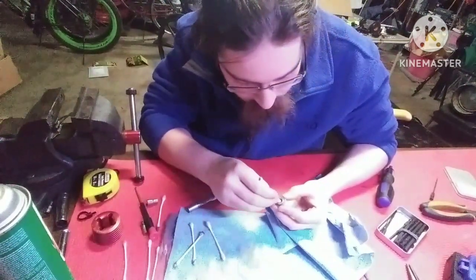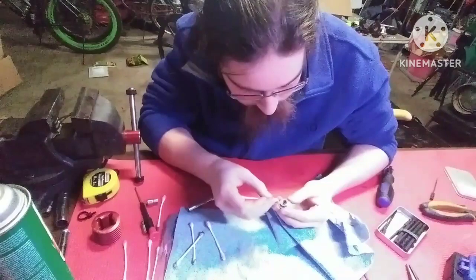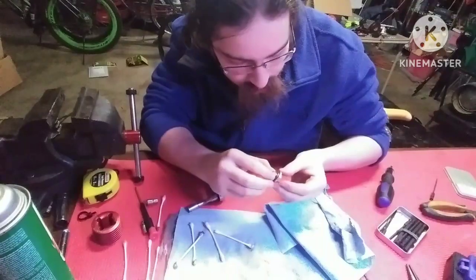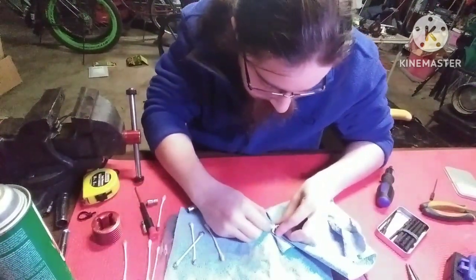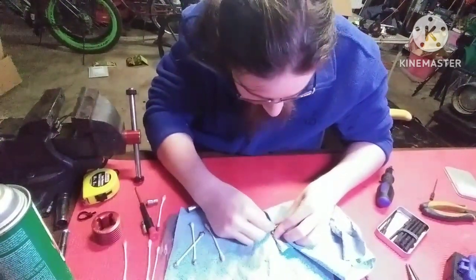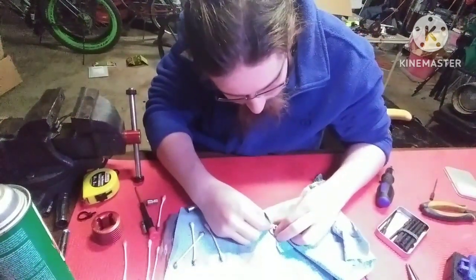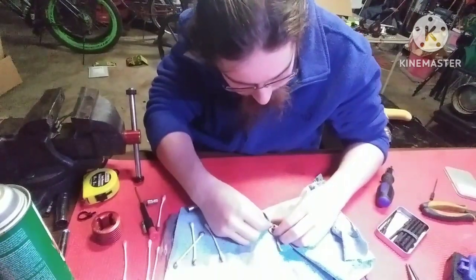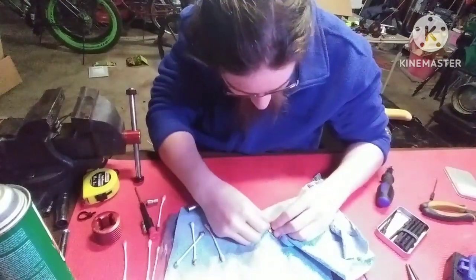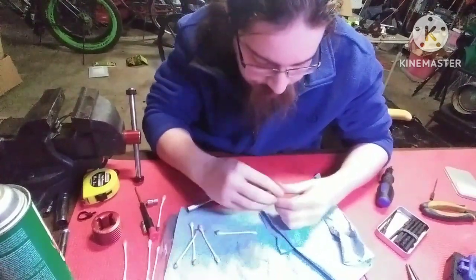Try and go in here without disturbing the glow plug too much. Alright. That is cleaner. I'm going to try and clean the top up, because this dirt and stuff will probably accumulate and then it'll cause your head not to sit all the way down on the button, so might as well clean it while you have it off as well as you can.